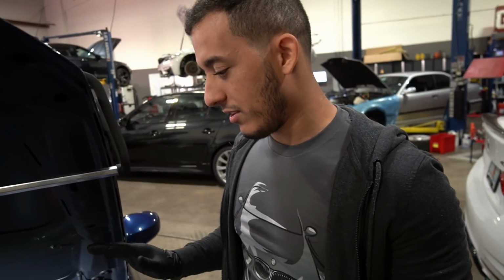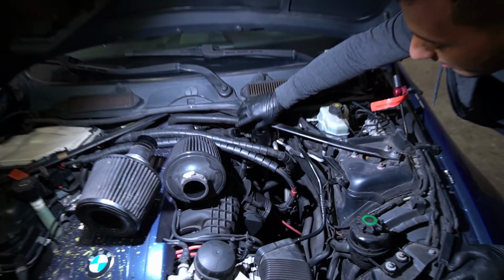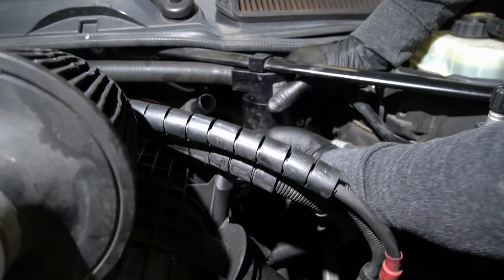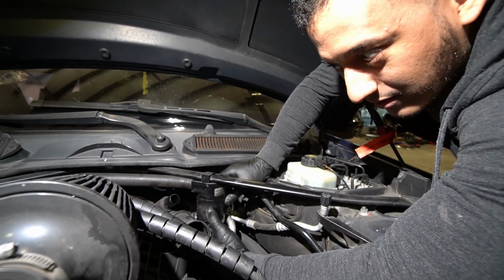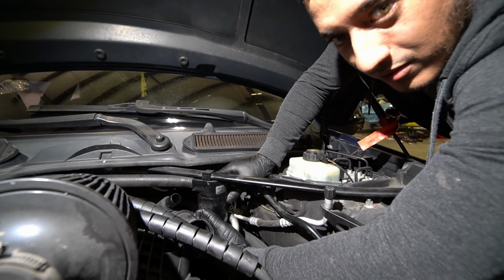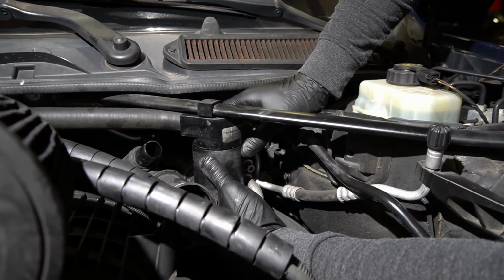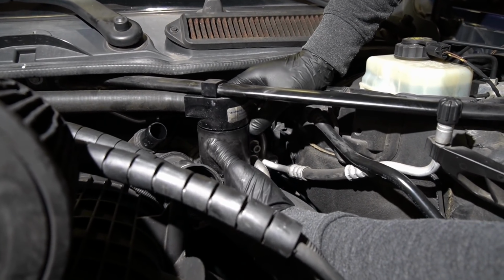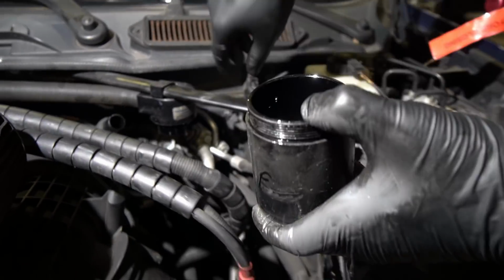So before I continue anything, I just gotta get this curiosity out of my head. All the blow-by that I was just talking about, it's even worse around the oil catch can. Like, I don't even think this catch can has ever been emptied. I can't even get a grip, it's so oily. By the way, if you guys are not familiar with what an oil catch can is, essentially it limits the amount of blow-by that gets into the intake system and makes it to your intake valves, and then makes your car run all inefficient. So the purpose is to stop that. But there's a lot of blow-by within the engine, and I feel like this is part of the reason. Actually, it's not full, but there's a lot of oil in there, and it's a lot of nasty oil.